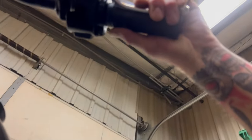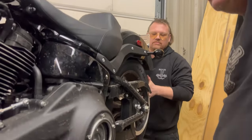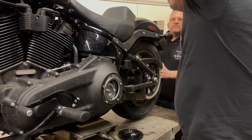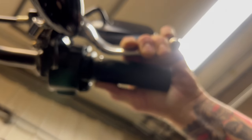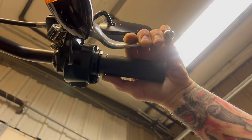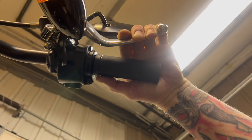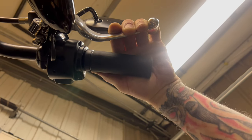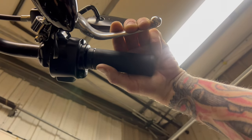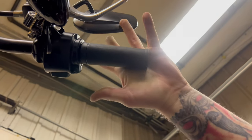You'll see Scott is going to be rolling the rear wheel. It rolls — it doesn't roll over easily, but it rolls over. Then you let the clutch out slowly, slowly, slowly. You feeling a little friction? We're starting to grab. You can see that we're a little bit more than halfway out from the bar.